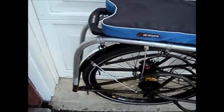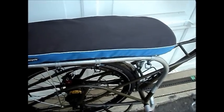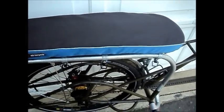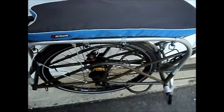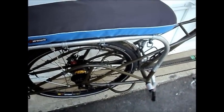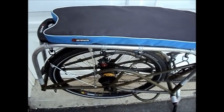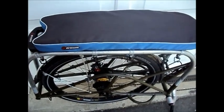The rack assembly I made myself with 3/4-inch EMT conduit and a conduit bender. I'll put together a video from the photo stream of when I did that. I actually did the entire mechanical build-up as well, though I didn't take any pictures at the time. I had this drivetrain in my mountain bike and transferred it to this, building it into these rims — it was in a much lighter-duty rim, too light for a cargo bike. The front wheel I built specifically for this bike.